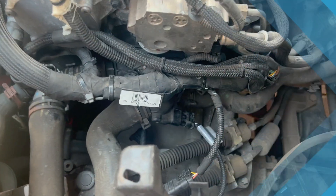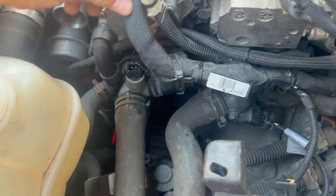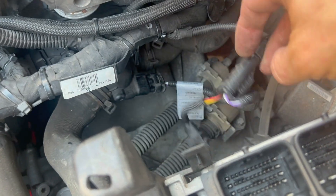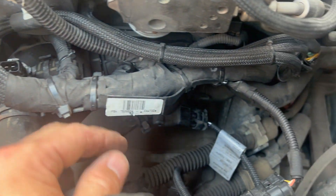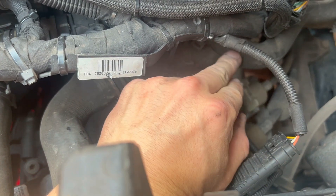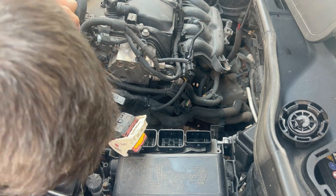As this becomes clearer you can see the different sensors — there's one of your coolant temperature ones, and there's the other one. This is that jumper harness that you don't need anymore. You can also see that this hose needs to come off, and that hose needs to come off. Highlight another two and then there's this hose and that hose — get them off first. You'll need various pipe clamps, grips, pliers and all sorts. Remove each of the coolant hoses from the thermostat, starting with the easiest ones closest to you.